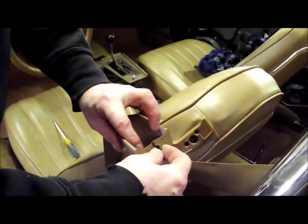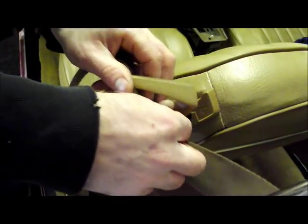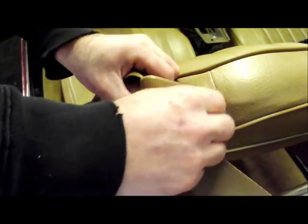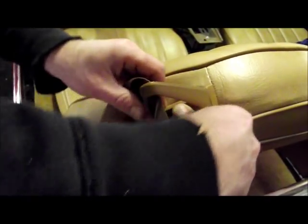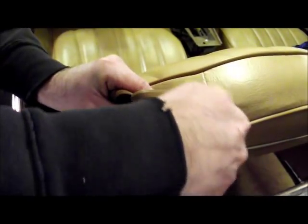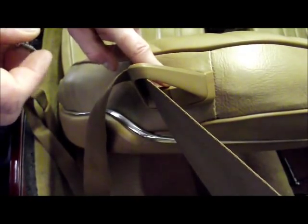On the bottom of the triangle you have two little pop tension clips and a large hole in the base. Feed one side through — a lot of guys will turn it sideways and then twist it in. You'll see how one side pops in first; that helps make it go in securely on both sides. As you tighten it down it'll draw even tighter.